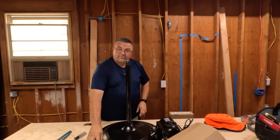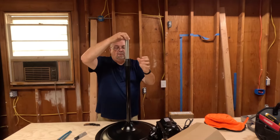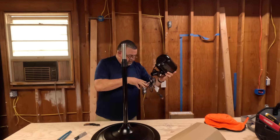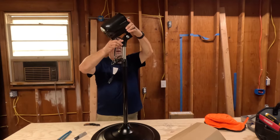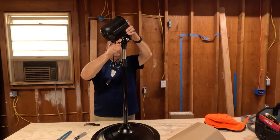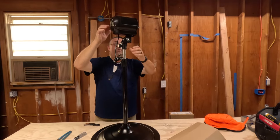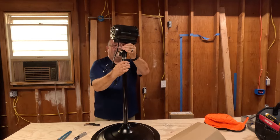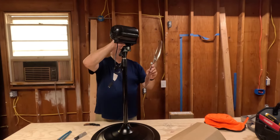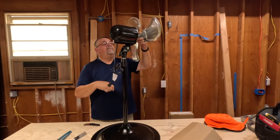The bell goes over and covers up all those screws — who wants to see all those screws? Nobody. Put this back on, leave it a little low. The motor just goes on here; it has a thumb screw — tighten that up — and the motor will tilt however you want it. Lower that down, and on the fan blade there's a set screw. There's a flat spot on the spindle and I'm going to put that set screw right on that flat spot.